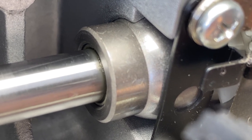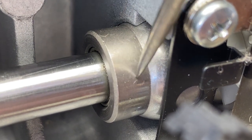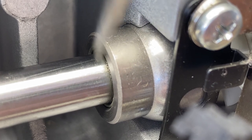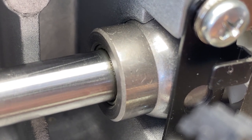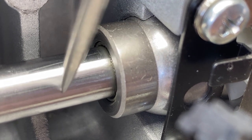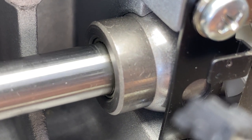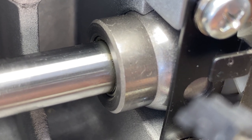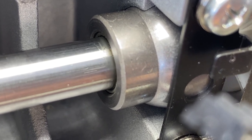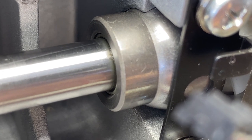As I turn it, right at the crack there is some black material — it should be perfect. That tells me the shaft and the bushing should be very smooth, and with the lubrication it stays smooth. When it begins to wear, the metal — usually starting from the bushing — begins to scratch the smooth steel, and eventually it will get worse and worse until it actually seizes up. It will stop turning because it gets so hot, and then once it cools down it will go again, sometimes briefly, and then seize up again.